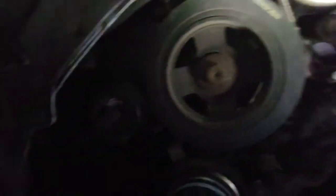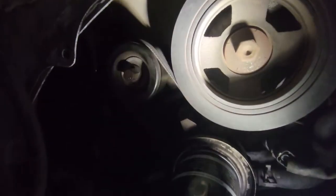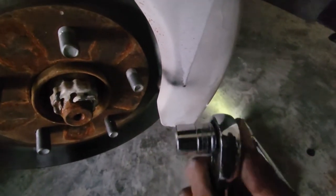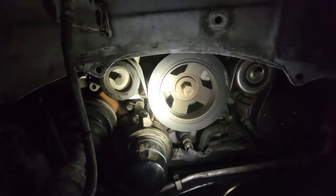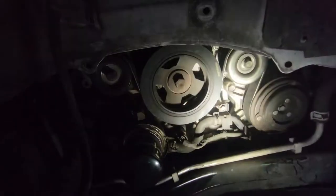The belt wraps around your alternator — go in between there, above that bolt, and then it needs to come around. And you've got this right here: your tensioner pulley. You're going to need a 14-millimeter socket. Place it on there and pull it down to release tension and pull the belt off.